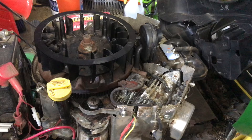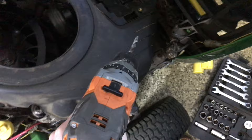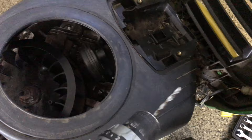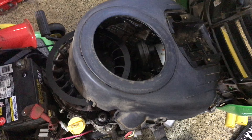So they don't go under the cover. With the cover away from the engine, what I'm going to do is take a drill and drill a hole in the plastic cover — just on each side where the mice like to nest. The idea behind this hole is so I can drop peppermint oil in here to keep them out, just a small amount each time I put the mower away for storage. Hopefully that stops the mice from getting in here and causing all sorts of havoc in my Deere.